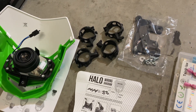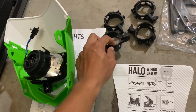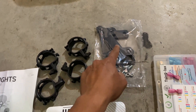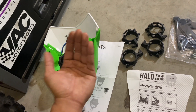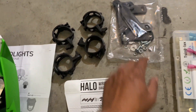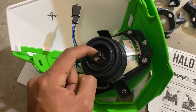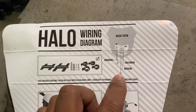Here's everything that came with the Polisport halogen headlamp kit. It's very simple — a housing, vibration reduction straps which you use to secure it to the fork. There are two sets of brackets: one is wider than the other, and you can bolt these onto the mounting points on the back of the headlamp to position it closer to or further away from the fork depending on your application. The wiring for the headlight bulb itself is very simple — the left pin is the ground and the top pin is for low beam.